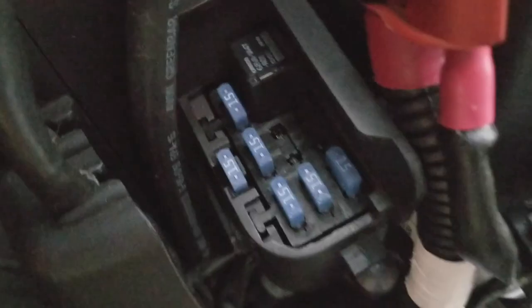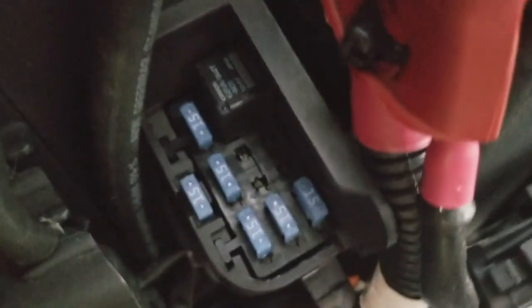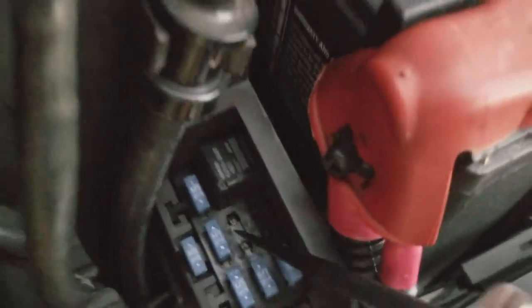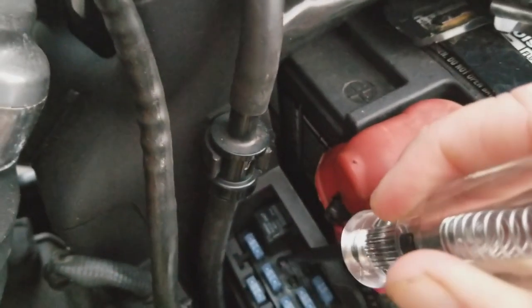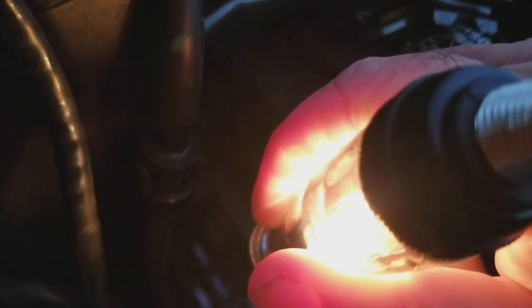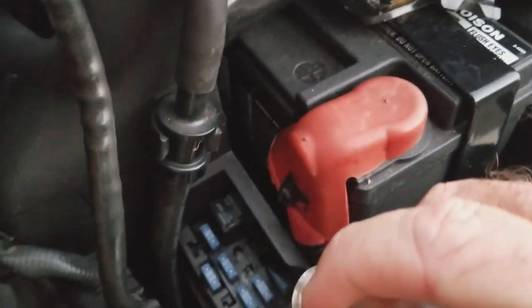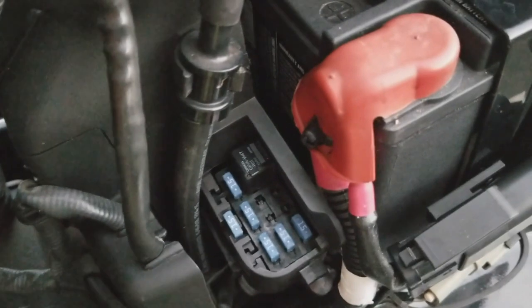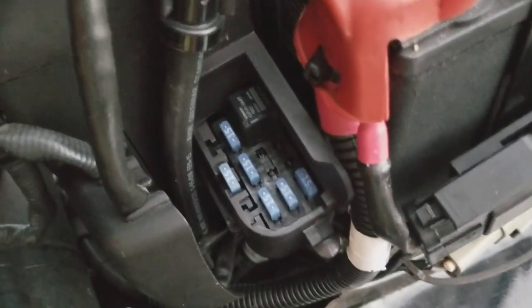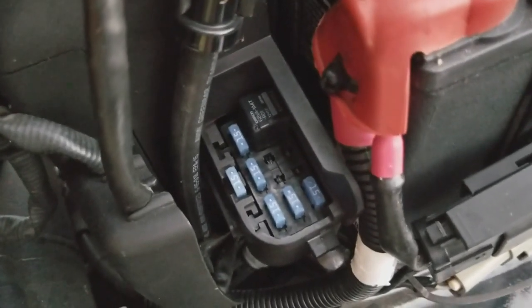It is the fuel pump. And then you'll see those four prongs. You're going to want to touch the one in the back to make sure it's good on the board. So if I can get in here. All right, lights on. So I touched that back one right here, and it's good because the others you touch, there's no electric, but that feeds the entire relay fuse here. So that's good to go. And then I did check the other, so those are all good. Everything on the board is good.